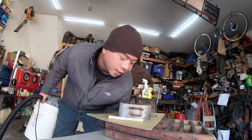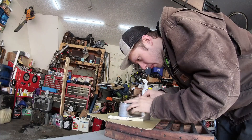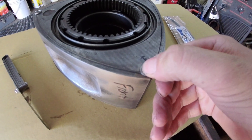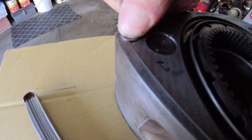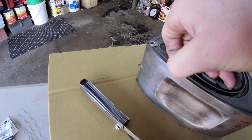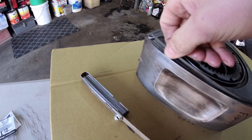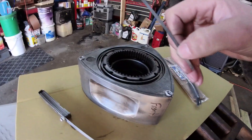This is effectively zero tolerance — see how it pushes the side seal up and down when I push on the corner. Too tight: there's no side-to-side play. Now we get to tackle the task of getting that last bit removed so we can hit our clearance, then we get to do this five to eleven more times.